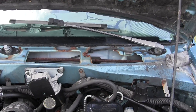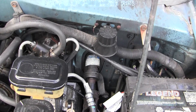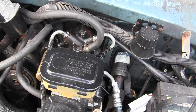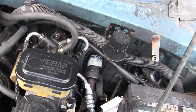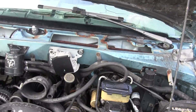I've got to keep shopping, but I've got a bad ignition switch. I ordered a new one and it went to the wrong address, so I'm going to forego the ignition switch for now. I have marked the fusible links A, B, C, and D as you see there, and I'm going to reconnect the battery and the fusible links and then ferret out the problems with the ignition switch later.